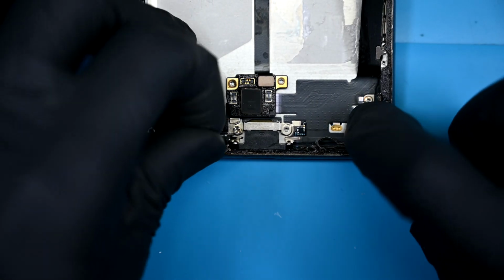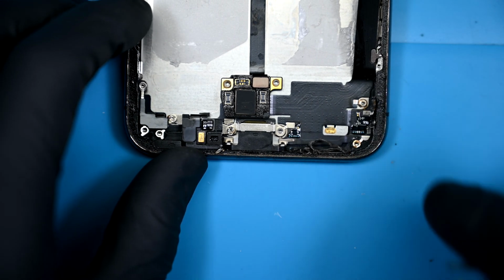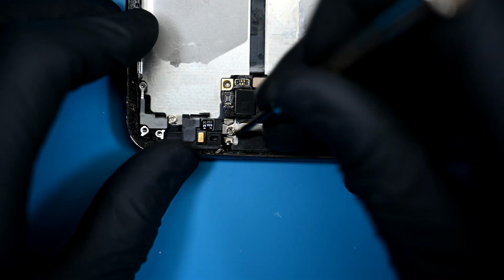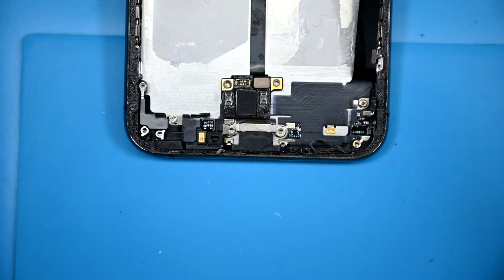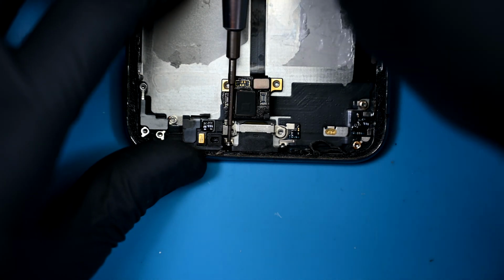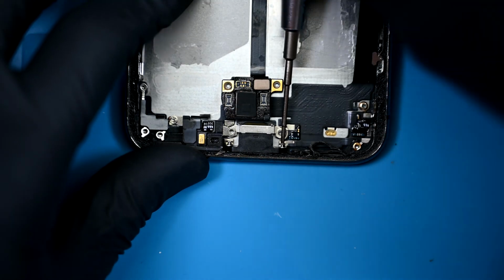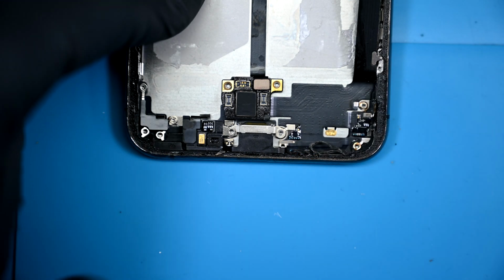With the cute little microphone shield removed, we finally encounter the standoffs. If you don't have a standoff driver, a flathead works just as well. Keeping a good screw map here is super important because there are a ton of screws. Remembering the order in which they came out is also critical to reassembling it properly. It'll help prevent you from making extra steps and having to undo misplaced screws.